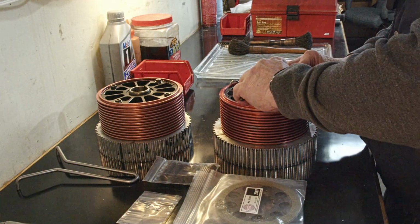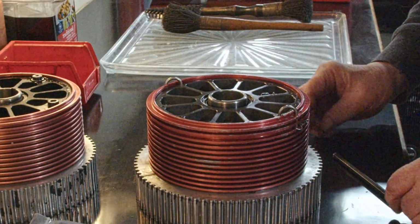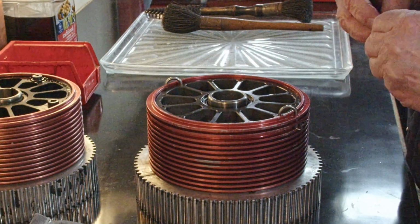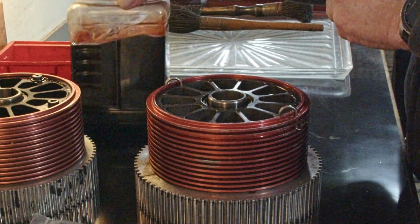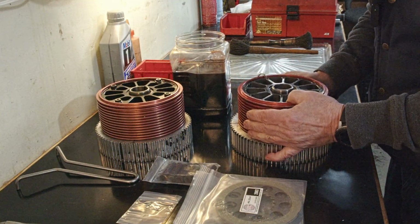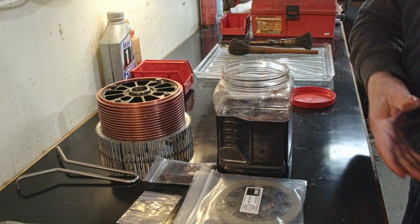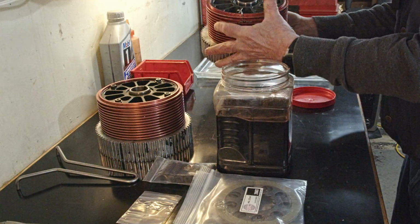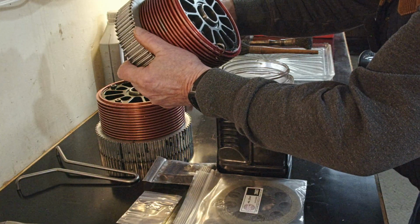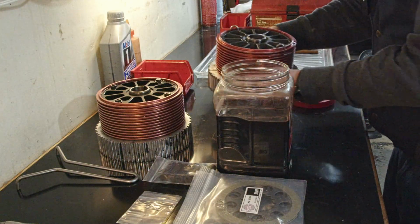And take the other plug out. I happen to know this particular clutch has just been rebuilt. So the only thing I really need to do is check the fluid. I know I just filled it up, or did I? So anyways, you open up a container like this to hold the fluid. You orient the clutch so you can check the fluid. Okay, so that is brand new fluid.